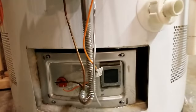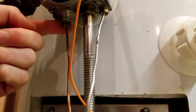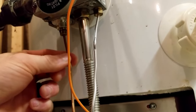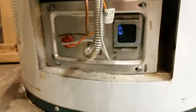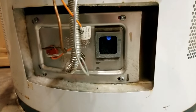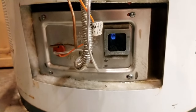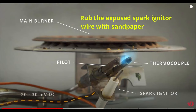But if that doesn't work, what you're going to want to do with the gas off is remove these three things from this box — this little wire, this one here, and this wire as well. Once those three are disconnected, you're going to remove these four screws, and then you'll be able to pull out the burner. I'll throw a diagram up on screen so you can see what it looks like. Give the ignition piece in there a quick rub with some sandpaper or emery cloth — just make sure everything's clean in there.